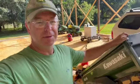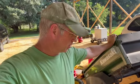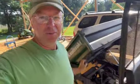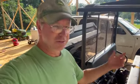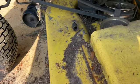I've had a lot of maintenance items piling up because I had to order parts. I'm going to start with one of the mowers — the pulley tension spring broke so I needed to buy a new one. For the other mower there's a flat tire; I thought it was the valve stem but it was actually the inner tube, so I ordered a new inner tube. And on the mule I needed new filters for the fuel pump assembly. Those have all come in, so I'm going to start reassembling and see if I can get all the vehicles back up and running — low hanging fruit first.